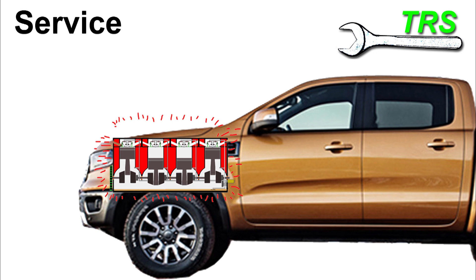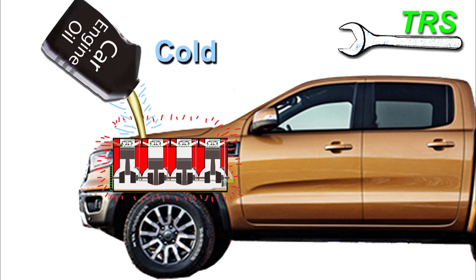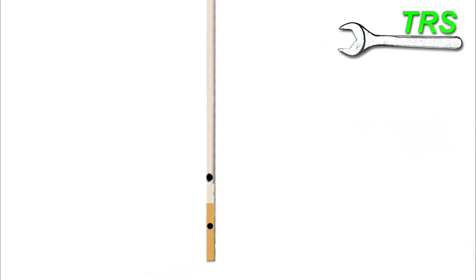In the situation where we're servicing the engine — warming it up to working temperature, draining the oil when it's thin, and then refilling with cold oil — we're not adding cold oil to hot oil, we're simply adding cold oil into a hot but empty engine. This is absolutely fine with no problem whatsoever. Unless I knew exactly how much oil the engine takes, I would still add a little, wait a minute or two, check the dipstick, then add a little more. This time the oil mark on the dipstick will be more definite since the cold oil is thicker and sticks better.